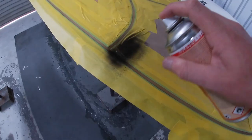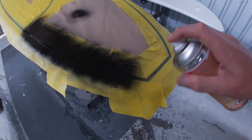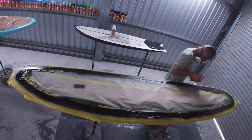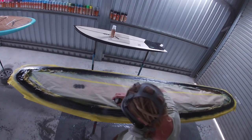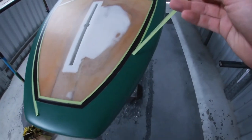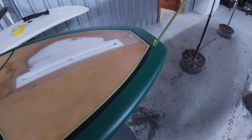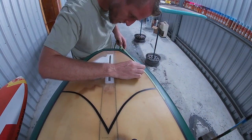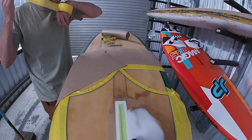When doing my pinstripes I like to do the first coat in short little bursts across the pin just to make sure everything is covered — saves a bit of paint and overspray. The second coat I do the same way I did the rails, walking around the whole perimeter spraying as I go. Same coats as the rail: two of black, two of matte clear, then wait for it to cure. Once it's dry, peeling the tape is easily the most satisfying part — watching that nice sharp line appear. After pulling all that tape off, we've only used about seven kilometres of masking tape so far. Now I'm going to mask off the black pinstripes, all the green, and the forward part of the tail patch, getting ready to put the red in.